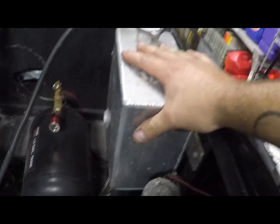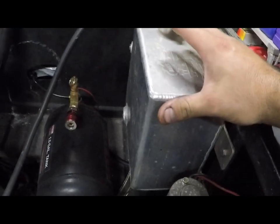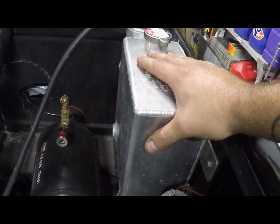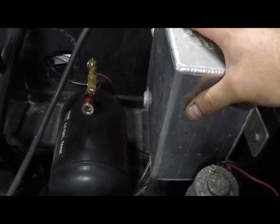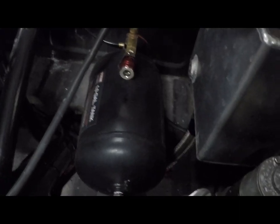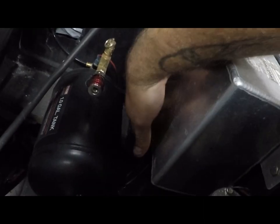Remember I talked about Monkey Fab Garage and Michael being able to build whatever you want? Well, this is one of those things. I said, "Mike, I need an expansion tank for my coolant system." He's like, "Okay, just tell me what you need." And I told him. So it's a dash 16 line all the way back here, and there's a T. And this tank right here is kind of like the overflow tank. It's the expansion tank, and it's T'd into that line.